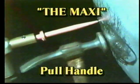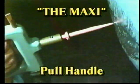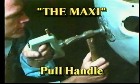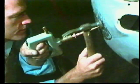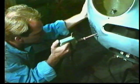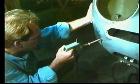The pull handle and a body hammer can quickly repair a damaged panel without the use of pins. Welding the pull rod is like having sticky fingers — weld, pull, and twist. No pins to snip or grind.